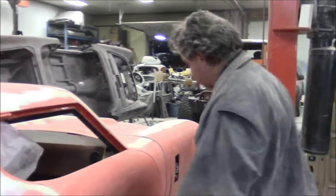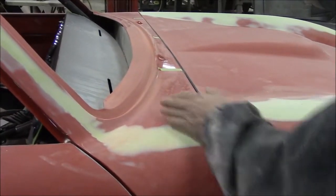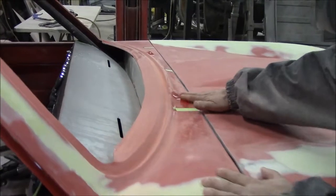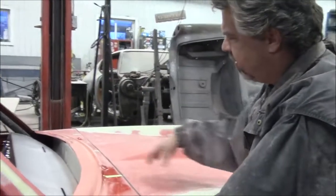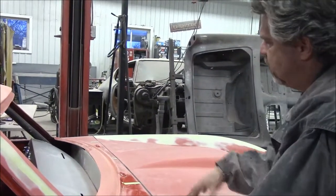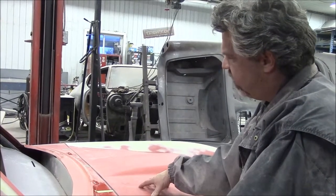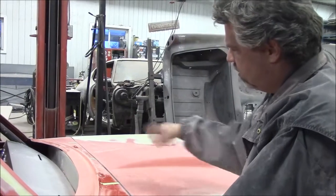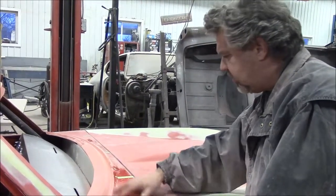You've got to be really careful about hollow spots and deal with them properly. We've done lots of sanding all the way around — the gel coat is no longer bright red, it's now flat red. We've got the seam done along both windshield posts and the top of the cowl is very close. We haven't done anything with the front cowl area yet because we haven't had a chance to dry-fit the wiper upgrade. We're in Ontario so wipers are required, and the client has purchased the Factory 5 kit. We'll do the installation in the upcoming week — measure, mark, drill the holes, install the whole unit, then remove it and continue the bodywork.